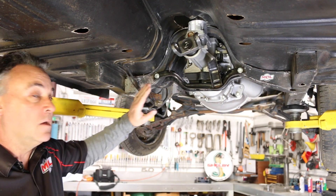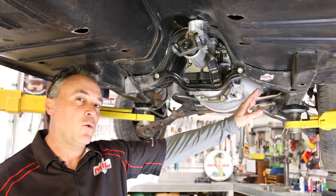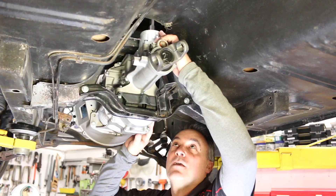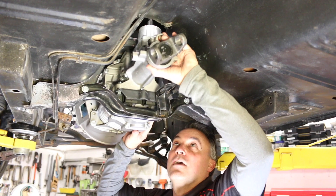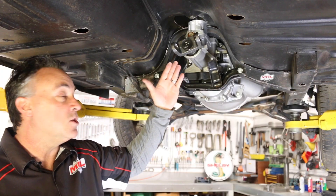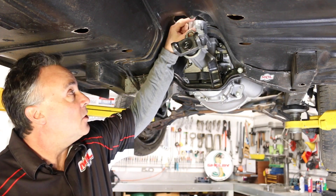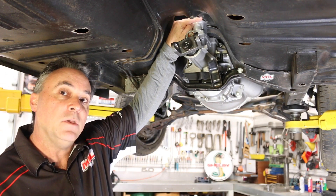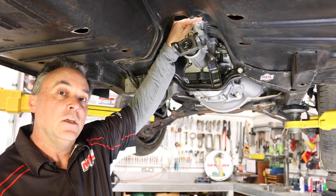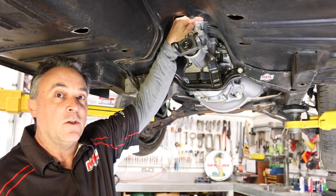The position of this floor support member is about two and three-quarters inches rear. We have shots we can provide to show you some clearance at the top and how to position the floor support in between the shifter and the casing structure. You'll notice we also have the same clearance issue with the factory Tremec shifter on both the T5 and the TKX — it hugs the right-hand side.